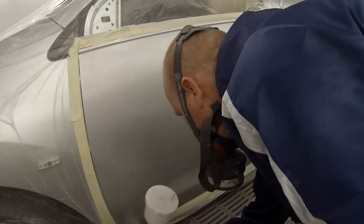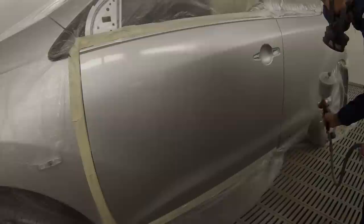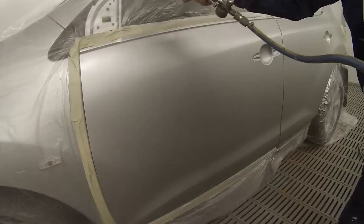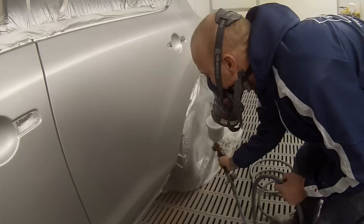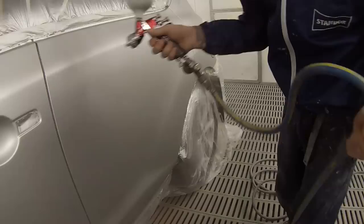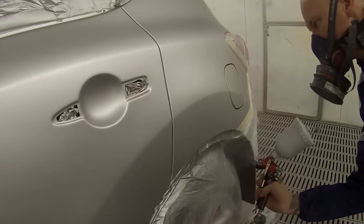This is what we call blending clear — it's basically just a clear coated base coat and you put that over where you're going to be doing your blend. As you can see it's still wet while I'm putting my last coat of base coat on, and you'll notice I'm putting this one on a lot lighter and a lot quicker than I put that second coat on, so as to make that metallic stand up nicely. I was just flicking it out so you don't have a dead stop and you're not going to see a big line down the middle of the door. Same thing on this door — nice and quick to get that metallic standing up nicely, and over that quarter panel where the colour meets up to the bumper bar and the tailgate I won't put any colour there, just blending it out with a flick of the wrist.